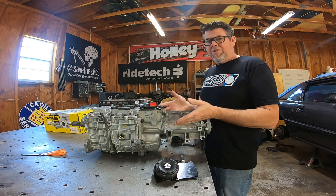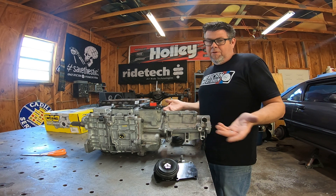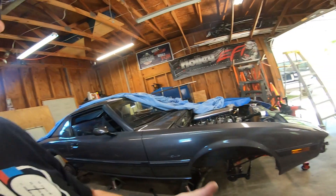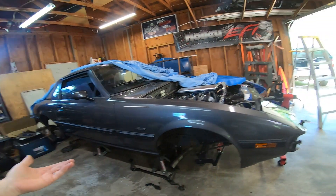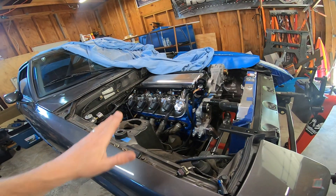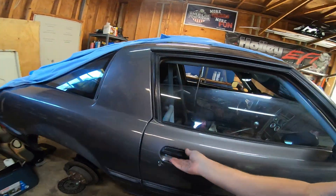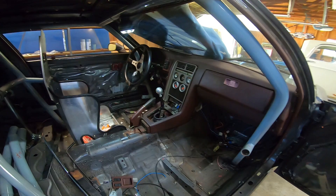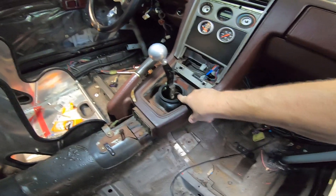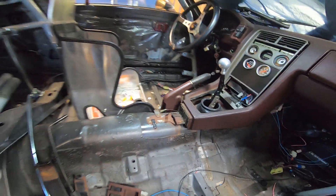Now let's say you've got a wacky import car with an LS swap and you're putting a TKO behind it and want a custom offset shifter. Speaking of that — this is our RX7 project we've been working on. It's a track day car for a friend of mine with a 5.3 LS and Holley EFI fuel injection. Behind it is a Tremec TKO five-speed, and we got the shifter to come out exactly in the stock location — just like the stock RX7 five-speed location — using a three-inch offset, straight back, which puts it perfectly in line.